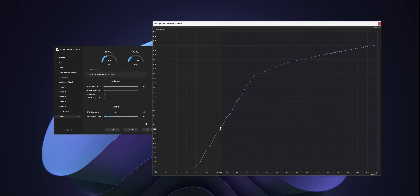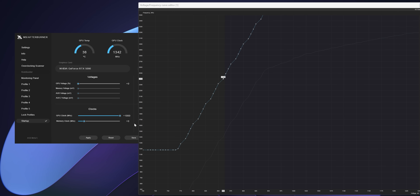It should be noted that there's likely a bit more juice left in these undervolt profiles. The big thing for me would be a way to set offsets higher than 1000MHz, or a less steep voltage frequency curve that may come via a driver or vBIOS update. Right after I finished all my testing, there was one driver update that gave me some hope — some users reported the 572.75 hotfix driver boosted their voltage frequency by a couple hundred MHz — but unfortunately it looked and behaved exactly the same for me. For now I'll simply wait until the driver situation is more stable before re-running all my tests.